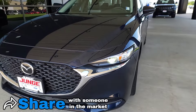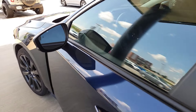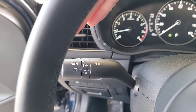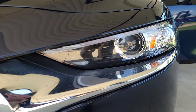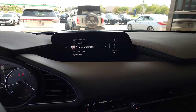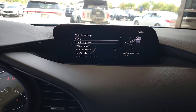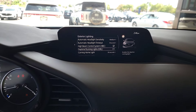You guys can see that your daytime running light's on. There are two ways to turn this off — one's a temporary fix and the other one's a permanent fix. If you just want to turn it off now but want it on later, the easy fix is to come over here to your light stick. Where it says auto, tip it to off. That's it — pretty nice and easy. That's a temporary thing, so when you put the vehicle in drive and get to a certain speed, your daytime running lights will automatically come right back on. For the permanent fix — if you never want these on while the vehicle's in motion — come over here to Settings, select Settings, go down to Vehicle Settings, Exterior Light, come down to Daytime Running Lights, and then boom, they're off just like that.